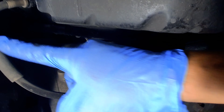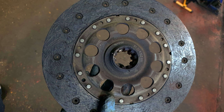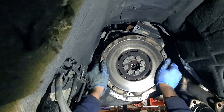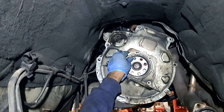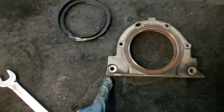I also wanted to change the shifter to a short shifter — there was a lot of free play in the gear linkage, so I changed it to a 545i manual shifter. Whilst I was there I also did some VANOS tests via BMW DIS, which is very cheap software you can buy. I also had some lacquer peel on the back bumper from the inspection video that was really bothering me, so I thought I'd address it with a DIY rattle-can job — and it was all going really well until...